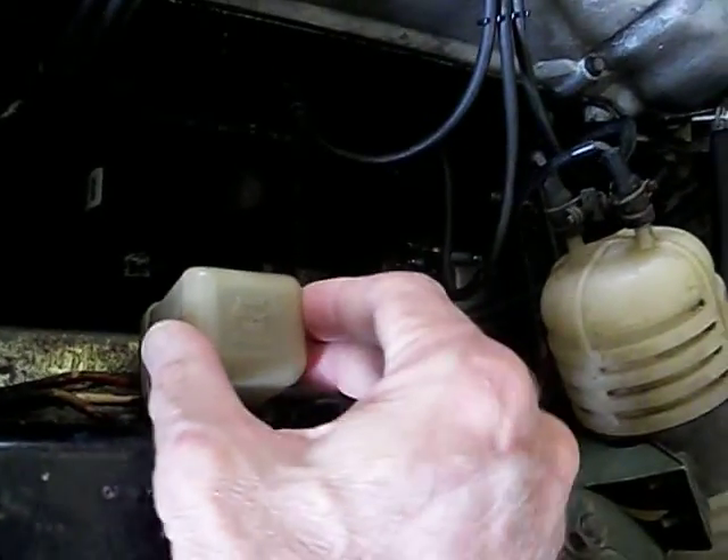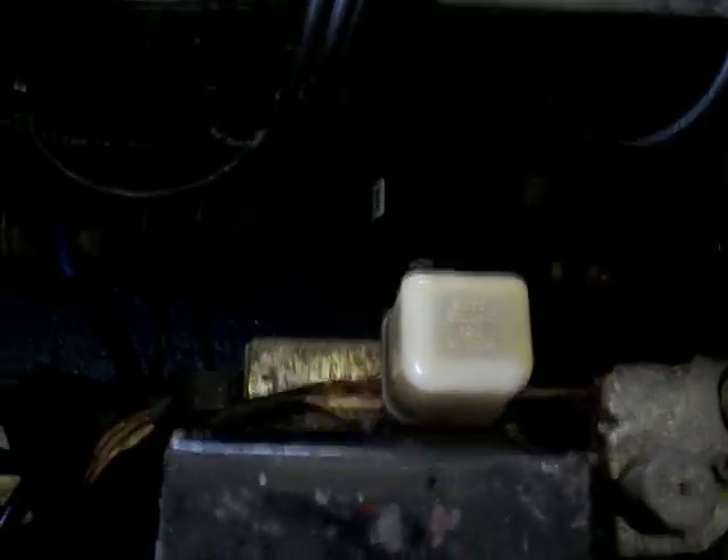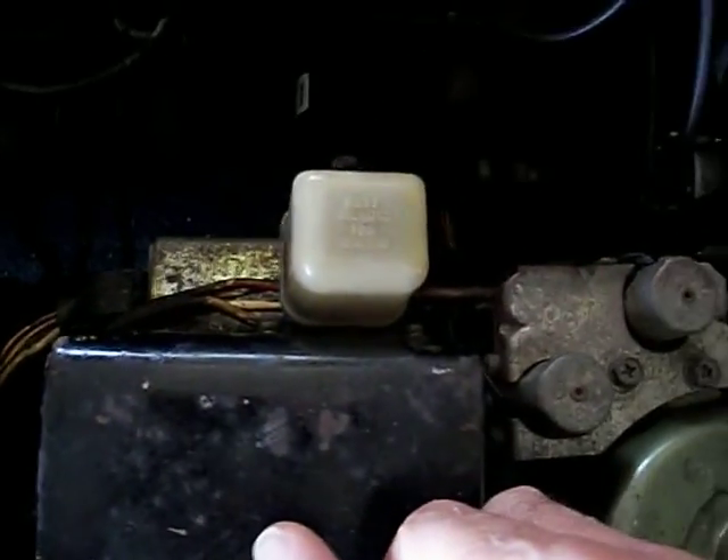There's a little plastic tie holding this on. This is our early '75 when they only had the one fuse link box — there are actually two fuse links in there. It was kind of loose and not very secure, so I ended up putting just a little dab of silicone — the same I used on the airflow meter — to make sure that wouldn't pop off. On the battery cables, I had to custom fit them because the originals weren't correct. So I've got a little copper connector, like you see in welding equipment, to hook up the starter ground.